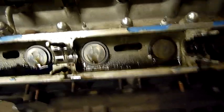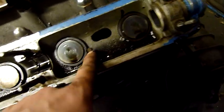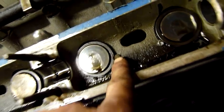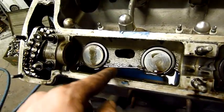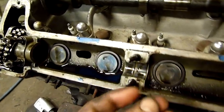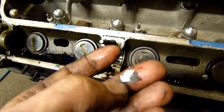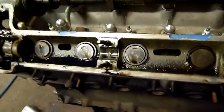Got one cam out and I found some fun stuff. It looks like they've been doing the valve buckets differently - pinning them in place rather than grub screwing. They've drilled and tapped right next to them and jammed bolts in, then twisted the heads off - bottomed it out and snapped the heads clean off, not even cut off, just snapped hard. You'd also notice these cam bearings are coming apart - that's been scraping against the camshaft, got nice big gouges through it. The old girl didn't have long to live. That bearing's gone.